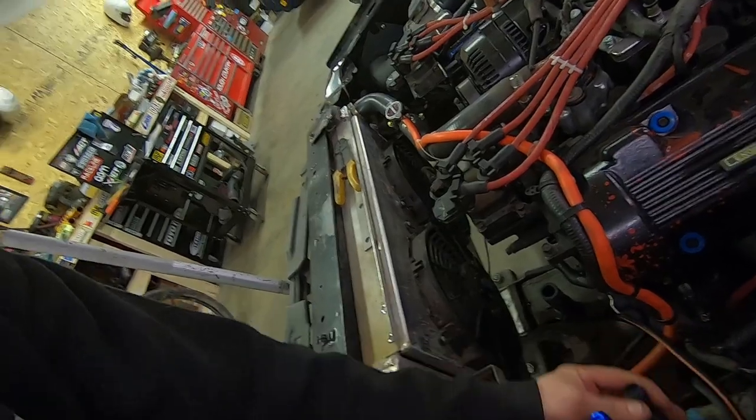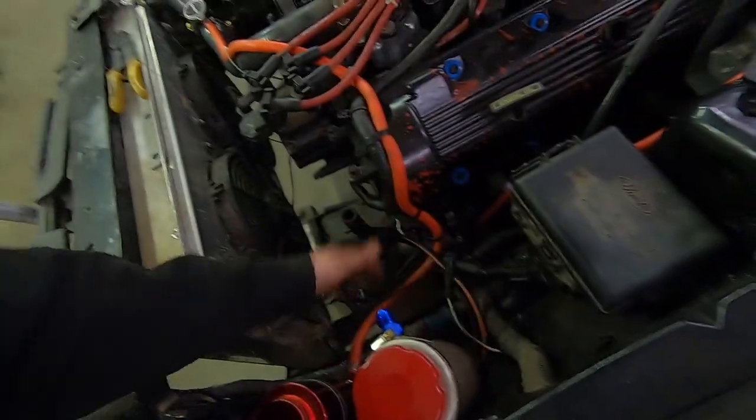This car is going to run on a push-button start this time. For some reason, after putting the engine back in, I don't get a starter signal with the key and I have no idea why. I've got this wire here - one of these wires goes directly to the starter as the signal wire. I'm just going to tap into that for the push-button start. I'll still use the key on the ignition to turn the vehicle power on as a safety measure, because I still have plates.